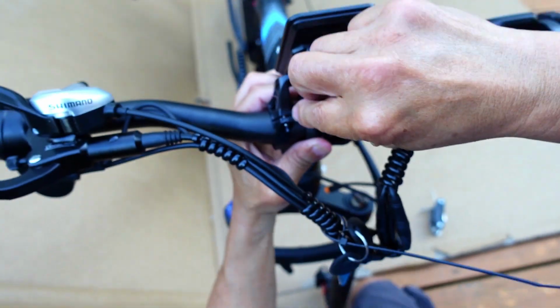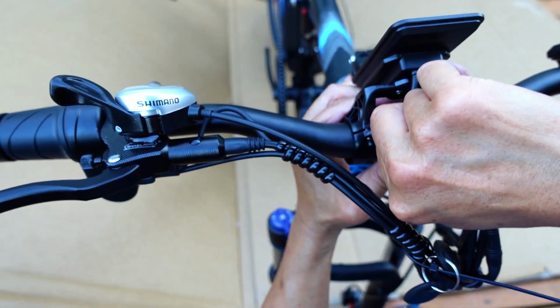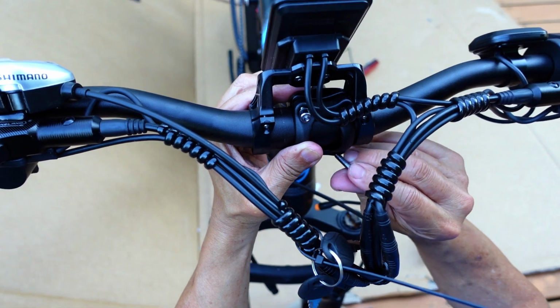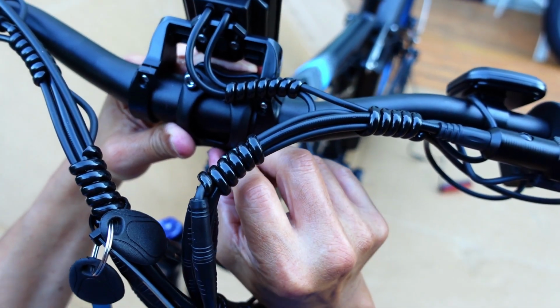First of all, you want to get 1 or 2 started, so start it by hand. Always start by hand, you don't want to strip it. Now, something like this, you want to tighten it with the crisscross method. This way you get even torque all around.